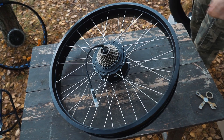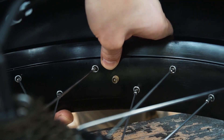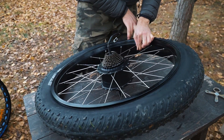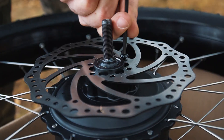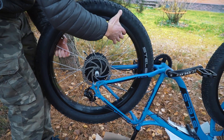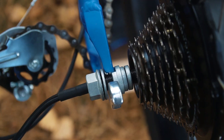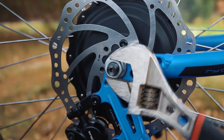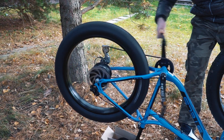Now we should put the tire on the motor wheel. If you are not able to do it with your hands, use some metal tools, but be careful not to puncture the tire. That's all — we can pump it up now. After that we mount the disc brake. Now we should install the rear wheel. Mind that you have to put it right — the disc brake shouldn't graze against the braking gear. You can adjust the position of the wheel by adding some spacers. And finally we put back the shifting gear. As a result we have a perfect idle run of the rear wheel, which is very important to achieve the maximum range on a single charge.